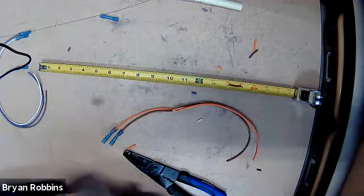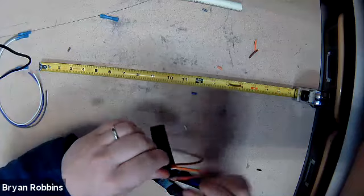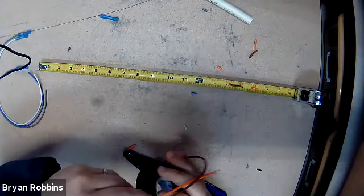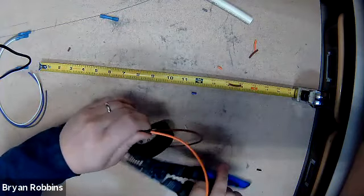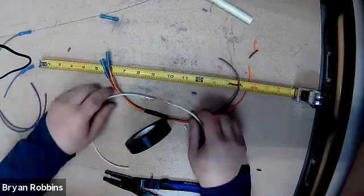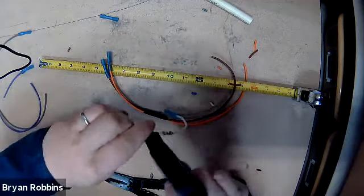Next, we need to put a little tape over this - just want to keep these from touching any other wiring segments. Not a lot of tape. We don't want to wrap this up really thick because the conduit this is going into has a pretty small diameter hole - we don't want it to get too thick with tape so that it can't slide through. A little bit of tape on there. There's also bare metal components here, so let's tape over that as well, just so we don't get any unintended electrical faults in our system.